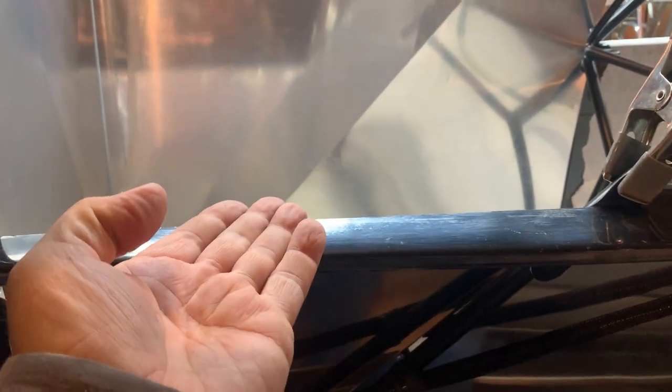I'm in kind of a fix here because I'm back ordered forever, I guess. The excess baggage frame, okay? And so I haven't installed my side panels. This stringer is just temporarily set in place with clamps. I've put all the other stringers in, but this baggage door goes in and you fit it perfectly. And then after it's fit, all these panels you secure. And then this bottom stringer you bring up to actually touch the bottom of the frame. And then we're gonna fill that in with body filler later along with our pieces here and here.